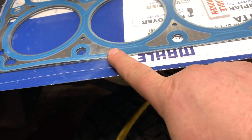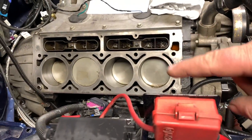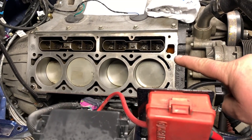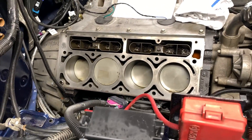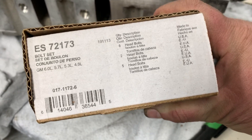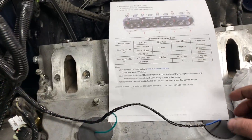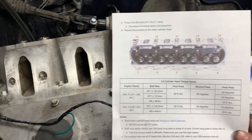The earlier blocks have three different sizes of bolts — the shorter bolts go in that hole and that far one. That makes a big difference when you go to buy head studs. The GM 6.0 bolt set — part number 5.75348 — comes with eight head bolts, two short head bolts, and five small ones. It's also good to print off a torque sequence sheet; I got this one off Summit Racing.